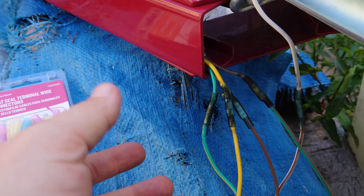So use a heat source, you're gonna melt the ends on there. I'm gonna wrap it up with some electrical tape just for good measure. And then these ends over here we are going to clamp onto their respective parts of the seven pin connector here and put it back in. How this one works — there's a little notch here, and then a little screw hole there. The notch slides in this way. There's that little groove there, and then in that screw hole there's just a tiny little set screw that sits in there to hold it in. You then feed your wires in through here first so that they're all sticking out, clamp them onto the respective pins, and then put the pin thing back in and set screw it down.